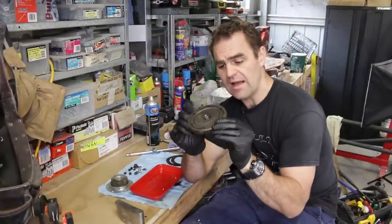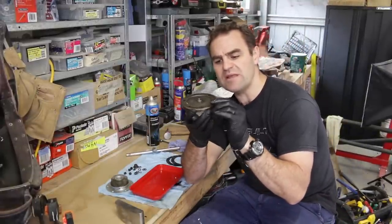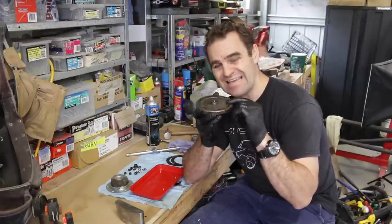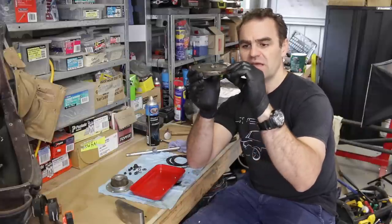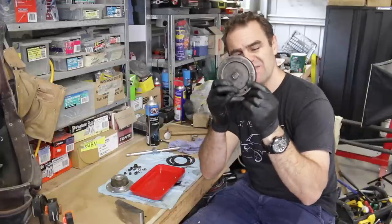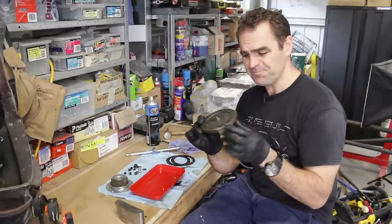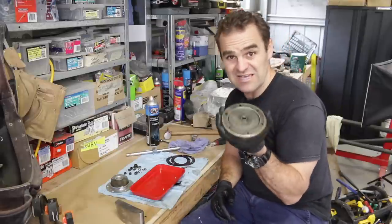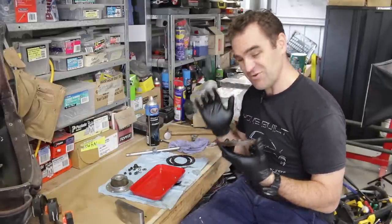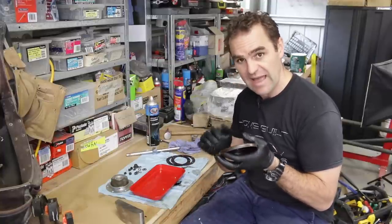Now I've cleaned all this stuff up, I've had a look at my sump plate. What's quite common is that people over-tighten these sump plates and then they leak, because on this one there's actually a little bit of — it's only on one of these bolt holes — there's a high spot where somebody's over-tightened it and it's sort of puckered out. This was leaking and I don't want it to leak anymore, so I'm going to attempt to try and fix that dent and just tap it back out again.